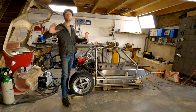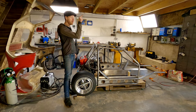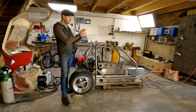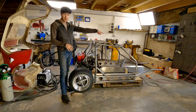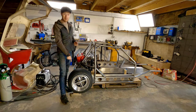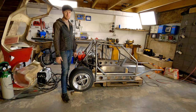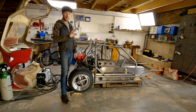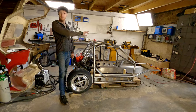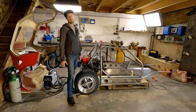The great thing about 14s is they're also available in a huge array of winter and snow tyres. The other great thing about a 195/55 is that I can run it on the front - it's the biggest tyre I can actually run on the front, and the kingpin inclination angle with these wheels is perfect. If I ever get a puncture, I can take a front tyre off. If I drive all the way to Morocco and drive spiritedly in the Atlas Mountains, I can put a front tyre on the back and drive home. If I put a space-saver spare on one of these back wheels, the 250-plus horsepower will just obliterate it. So I'll take a front wheel off, put it on the back, put the space-saver on the front, and tootle home.